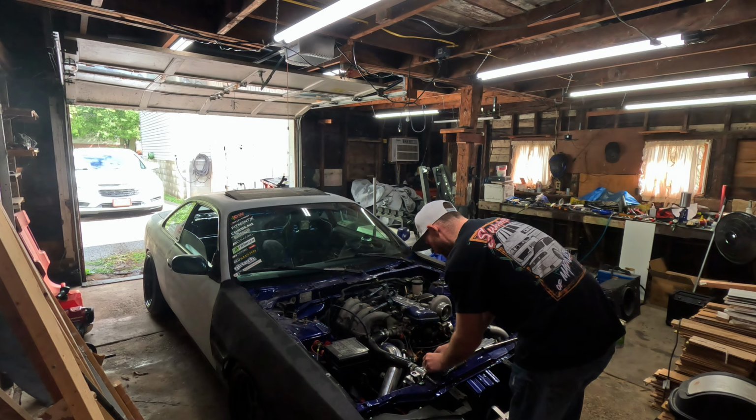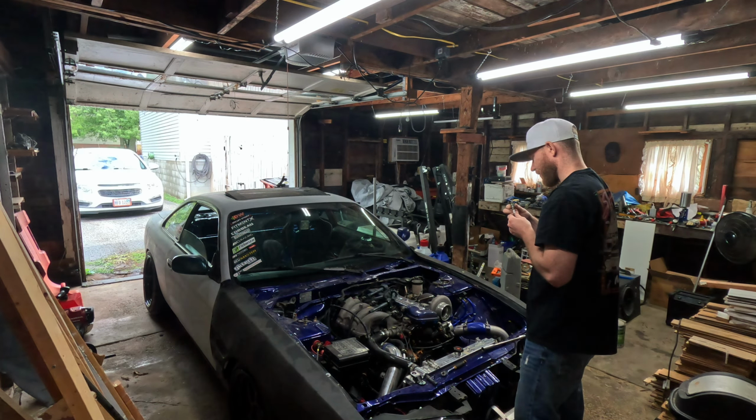That's one, that's two, okay, number three, it's looking about the same, and number four, same deal. I believe all of these are still gapped to that 30 thousandths, maybe a little bit more. I'd like to bring that gap down just a touch, maybe around 25 thou or 24 thou, and see if that might help. I think everything that's happening so far though is all within the tune.